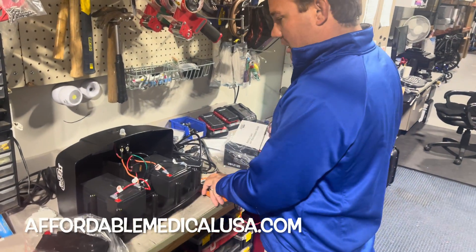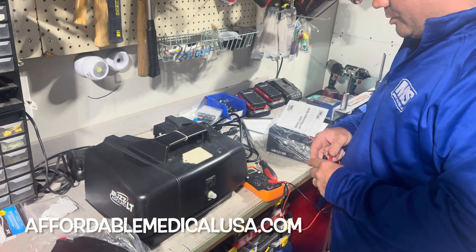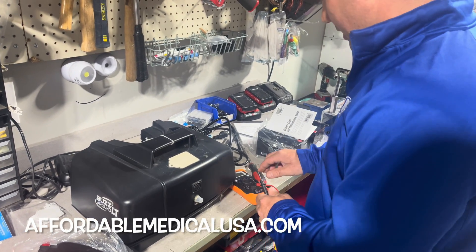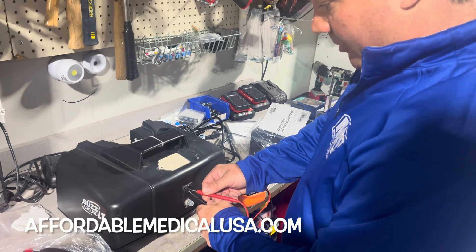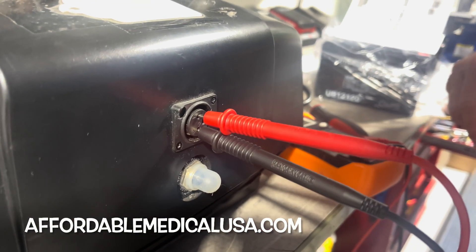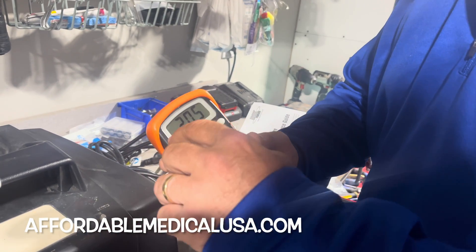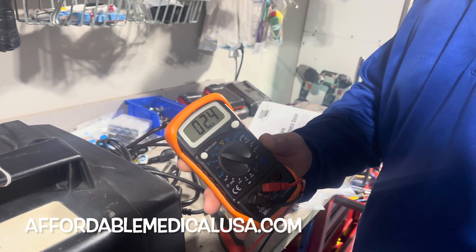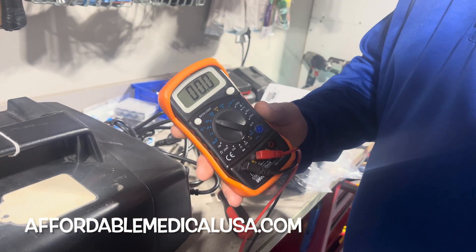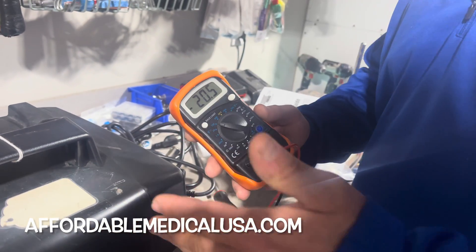We're going to set this on 200. Let's say this thing was put together completely — I took all the screws out, doing a battery changeout. You put them in here; it could be either way. The two top ones at the bottom — if it's reversed, you're positive-negative flipped, so you'll have a negative line here. See the negative. We're at 20.5 — this scooter's not going to operate.